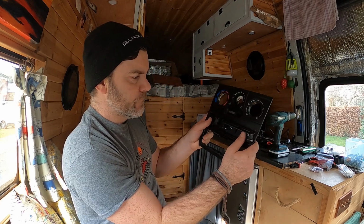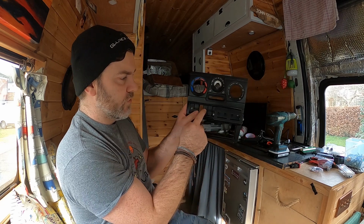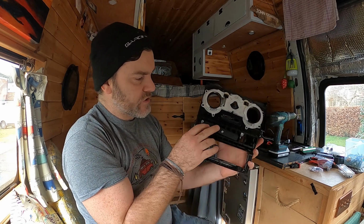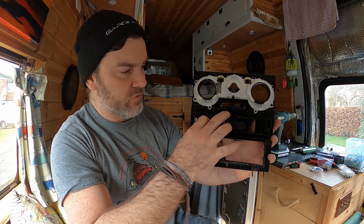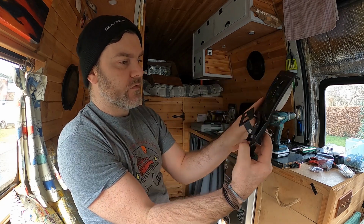Anyway, what I've done here is I fitted this. I haven't screwed it tight yet, but I've drilled 2 holes through the 2 of these blanking switch plates. And then on the back I used that other bar that I mentioned. I've drilled another hole in the middle of it, so that it braces across not just those blanking buttons but across the whole thing, so that's going to be really rigid in there. So yeah, that's what I'm doing.